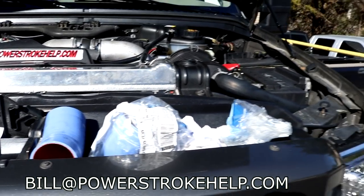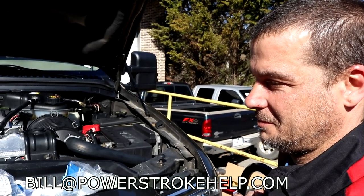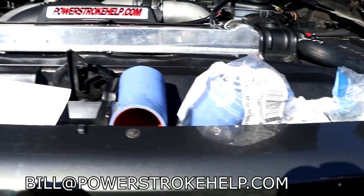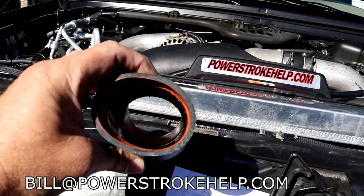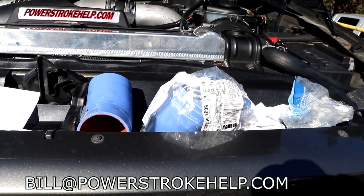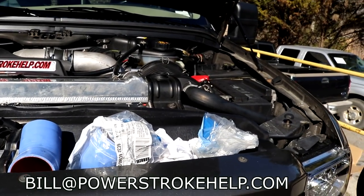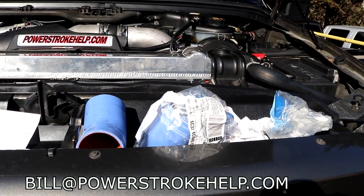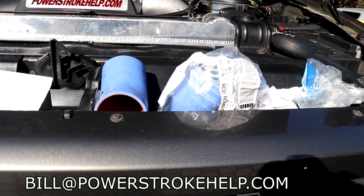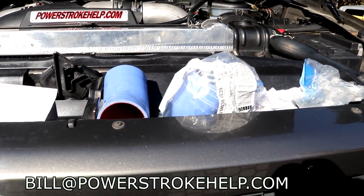They will. But if you're going cross country and you're pulling a trailer and you've got a bunch of screaming kids in the back seat and all the rest of that, it'd probably be a good idea to either change this before you go or inspect it to see how much oil is in it, because this thing's going to pop off in the middle of the night with the rain going sideways, and your truck is going to lose all power. It'll just absolutely fall on its face, and people freak out like, oh, I blew it up, because now it's smoking. It's like, no, it's delivering fuel, but not enough air molecules. So you've created a much bigger problem.